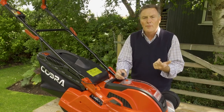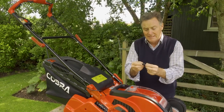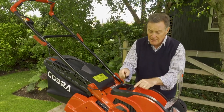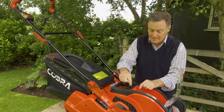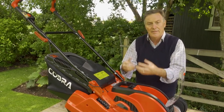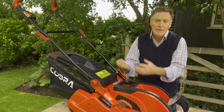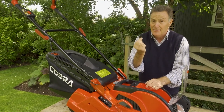While the batteries are charging, there's one more thing to do with the mower. You will have one component left — a small black plastic key — and that is essential to be able to start the mower. If we lift the flap, the battery compartment is where the battery will go when charged. You'll see a small keyhole slot — it has two settings, zero and one. To start the mower we click it round onto one; at zero it won't work. As a safety device, it's always good to take it out when you're not using the mower so nobody can accidentally start it.